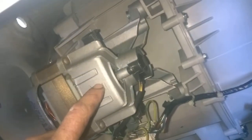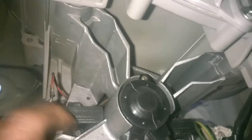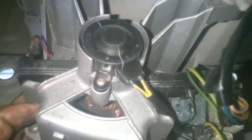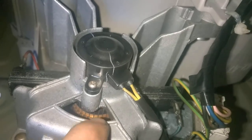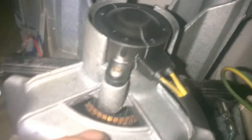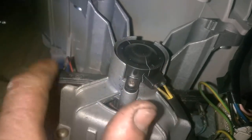Now we have the machine laying on the floor. Here's our motor — there's one brush, another one right there. I wanted to show you the commutator, because when the brushes are worn out, the commutator is all blacked out and damaged. But this motor is enclosed so we cannot see it directly. I'm going to remove the brushes — and look at that, there's the commutator, those copper bars. See how they have the copper color on the bottom part but are all black and scratched on top. This tells me that arcing has been going on for a while, so the brushes are worn. This is our problem and we are going to fix it.